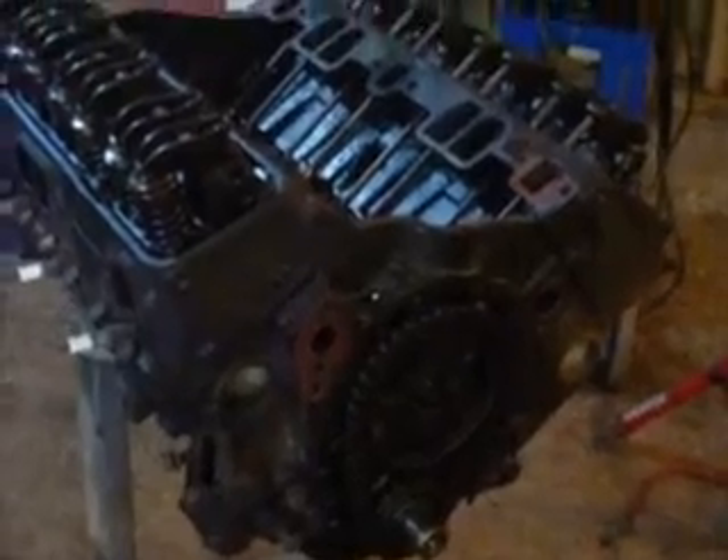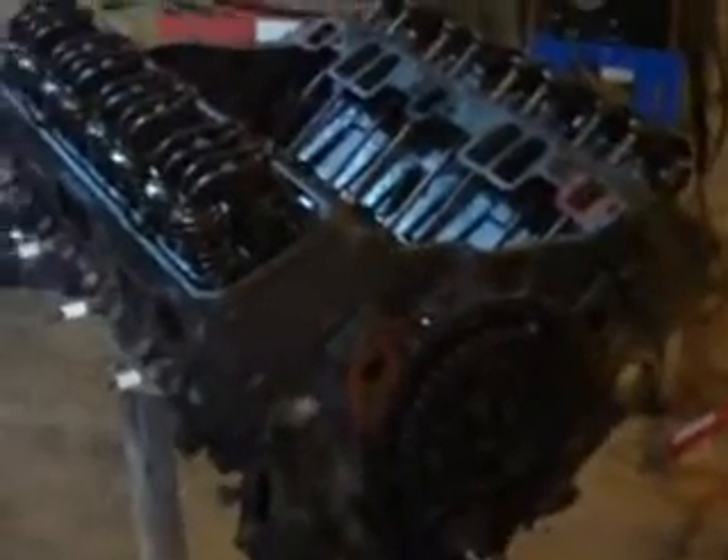In place of that 305 — it's probably pretty tired. I've decided for the power and the money it'd be easier to just freshen this one up. I pulled the oil pan off and looked at the rods and they do appear to be factory original. If this is the factory original motor it's never been touched — it's got less than 70,000 miles on it. The gaskets were hardened and leaky so it looks like crap, but looking in the oil pan there's very little sludge at all, so I'm optimistic this is going to be a pretty easy engine to rebuild — maybe just re-ring it and put in new rod and main bearings.